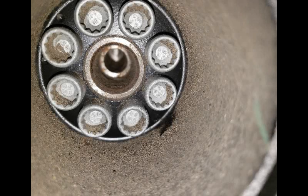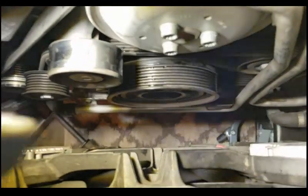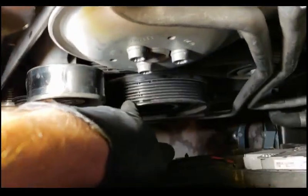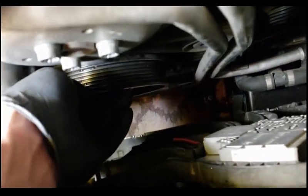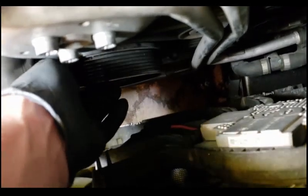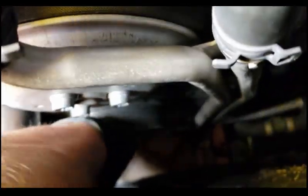Here's a picture of the original crank pulley — the bolts inside are triple square size 10. I had to take a picture because I wasn't sure what kind of tool I needed. Here I am struggling after unscrewing it, trying to slide off that pulley. I actually didn't know it's a double pulley, so you have to remove the other belt that's on it — you need to loosen up that belt in order to slide out that pulley.